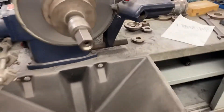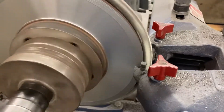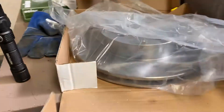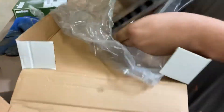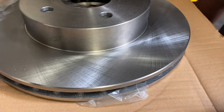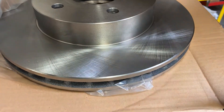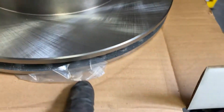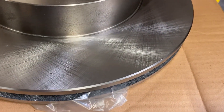Let's take a look back at our rotor and see how it's doing — it's about almost done, just a little more area to go. Let's show you what a brand new rotor looks like coming out of the box. If your rotor is bad, you'd have to replace it with a new rotor. The problem with a new rotor is they put oil on it, so you need to clean it with some brake cleaner so your pads don't slip. They also put a special crosshatch pattern on it to help the brake pads break in — that's what the factory surface looks like.